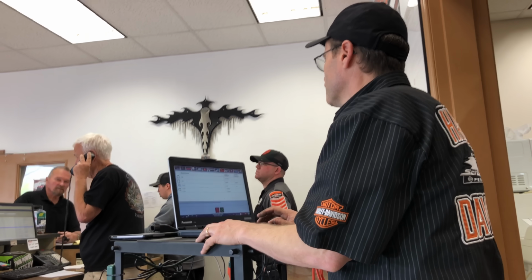So my idea was, let's hook this up, the WHIM, or the Boombox, I should say, to a digital technician, which is a proprietary software that only dealerships have. It allows you to get into the bike and adjust an array of things along with all the Boombox settings that we don't have access to. So I thought, well, let's just go ahead. By the way, when you first install the WHIM, you will have to go to the dealership, and you do have to have it flashed basically so that it recognizes the WHIM.